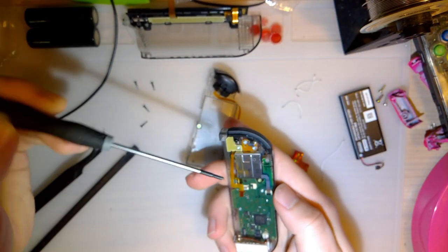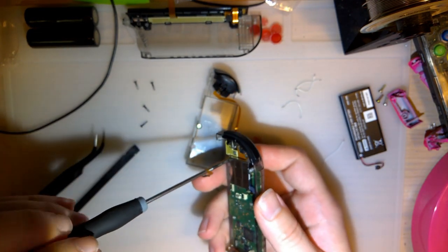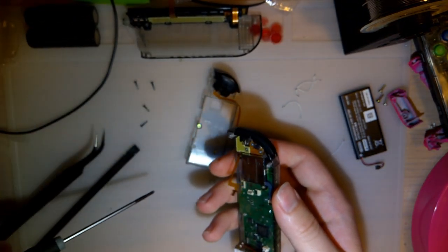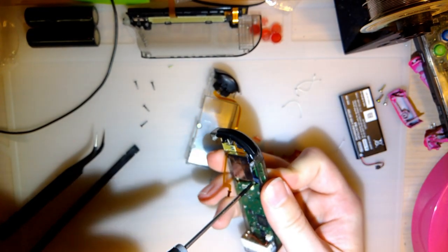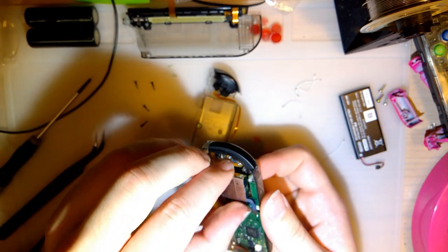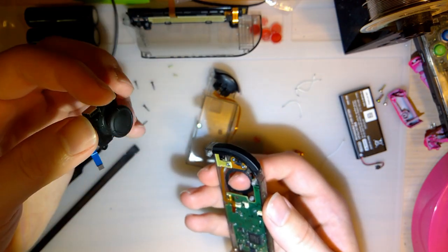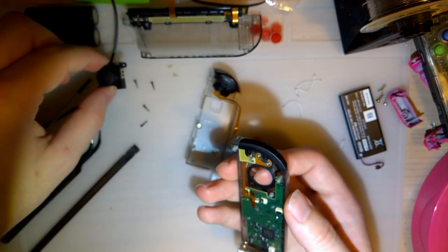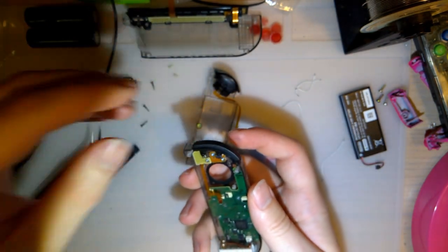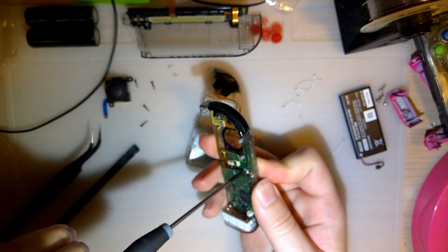Distracted. Okay. That's my Phillips screwdriver. Alright, so to pop out the joystick, it's just these two screws. And by the way, these parts are universal, so you can put the left one in the right Joy-Con, or the right one in the left Joy-Con, or whatever. You know, this isn't paired to the left Joy-Con, is what I'm trying to say. Alright. We're in the home stretch, folks.